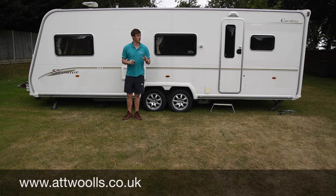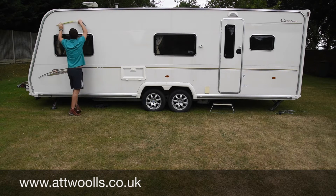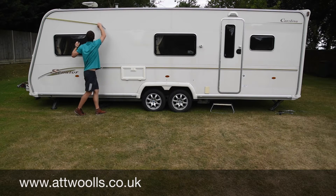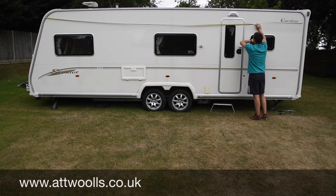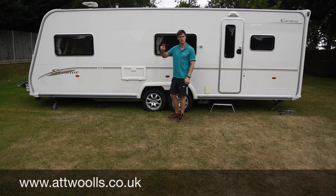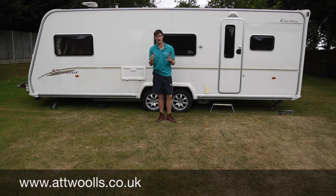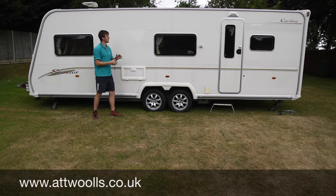So we'll get a quick measure just to clarify what we're looking for. Starting near the top of the rail and going across — we're talking five metres there, with a bit extra. Mainly because it's a twin axle you can pretty much fit anything you want onto it, but obviously smaller caravans makes quite a bit of difference. Awnings normally have a number after them, like 360, 420, 400 — that normally refers to the length they are on the rail at the top. That's just the main body. A lot of the time you'll have little wings and things on there; that measurement isn't actually incorporated into it, because you can position those wings down around the curved part of the awning. But the main body of the awning needs to be on that flat bit of rail, just so it sits nice and level.